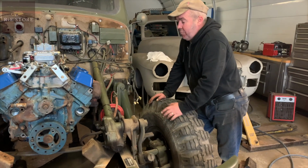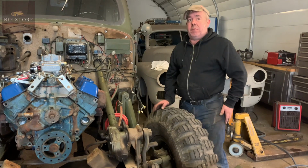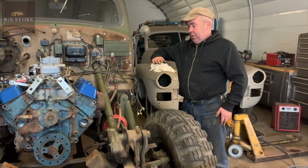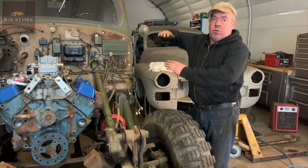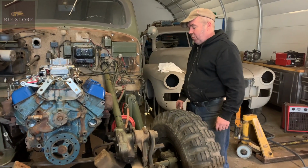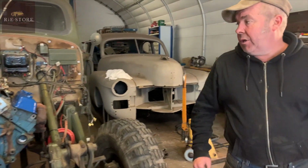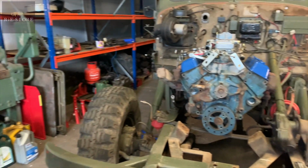I'll make the front engine mounts, and then the thing to do after that is pull it out again and make the prop shaft, and then you can set your height, because the front engine mounts will move that way, they won't move that way. So we need to get it set up exactly where we want it now. But half a degree out on pitch both ways isn't going to make any difference. Like you say, it's almost lost in there now, isn't it? It's incredible, isn't it?